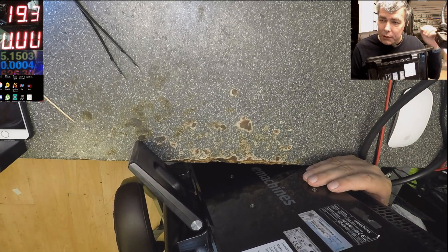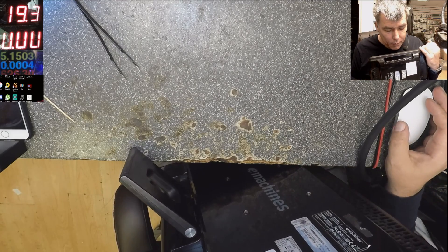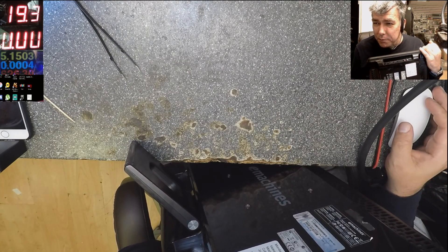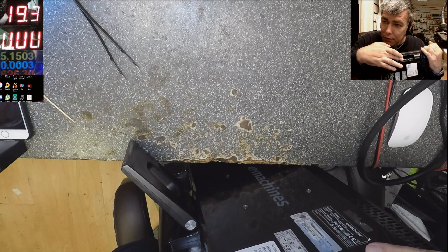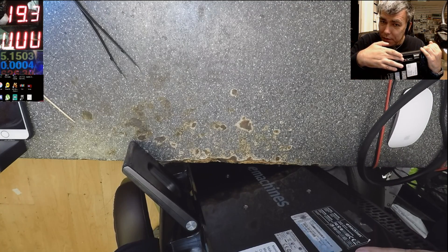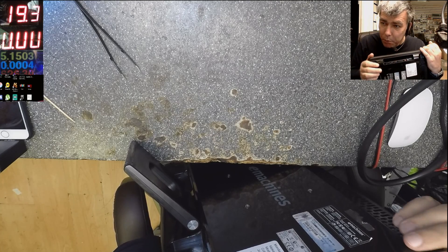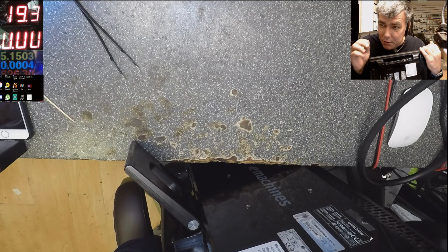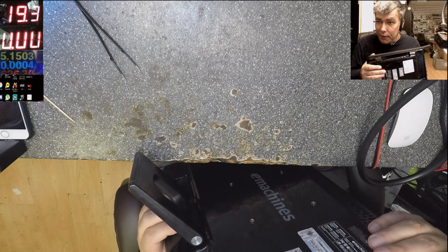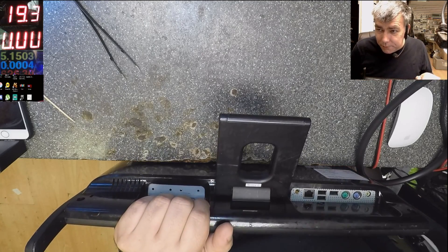You ask me what I will do next - I will not replace the USB port. That would be a hard job and the customer has to pay a lot. Instead, I will fill up this hole with hot glue. That way I'm sure the customer will not bend the pin again to touch the ground. So if you have this behavior, check the USB ports.